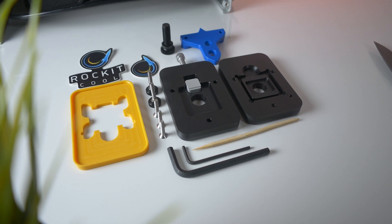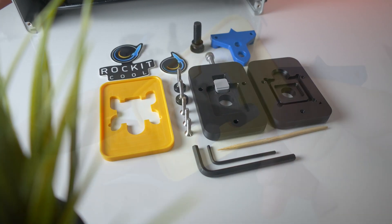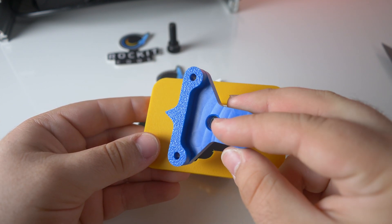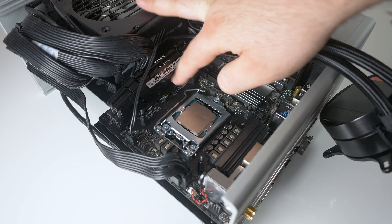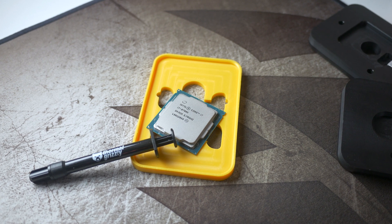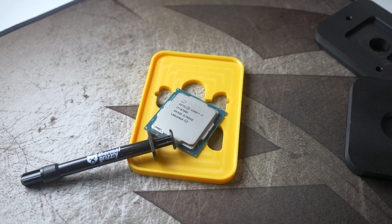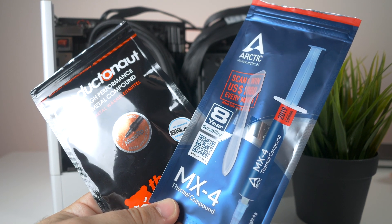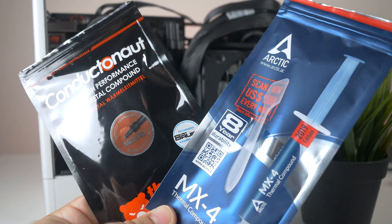The kit I purchased — which I will link everything in the description — honestly isn't as bad and feels pretty well made. It also comes with a template to relid your CPU if you decide to go that route. I decided to leave the CPU delidded and rely on the CPU socket to squish the IHS onto the CPU chip. Most people that delid go with this route, as reliding isn't the smartest idea because most users use liquid metal, which eventually requires the user to replace it with age. Liquid metal does not last nearly as long as good quality non-conductive thermal paste such as Thermal Grizzly Kryonaut or Arctic MX-4, so definitely keep that in mind.